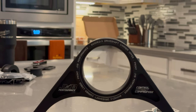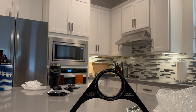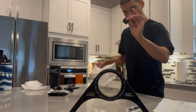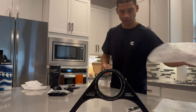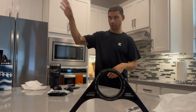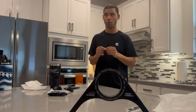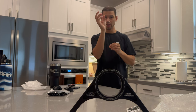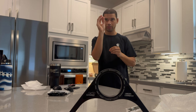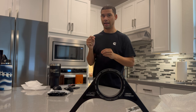It's not a whole lot of work to do it either. We take out the mid pipes. Oh, there was a thing on that side too. Take out the mid pipe, boom, it's a V-band and whatever slidey type. And then the heat shield, which I think is like four or five of them, like little twisty Johns, the little metal guys. They push on, but they twist off, and then we should be there.